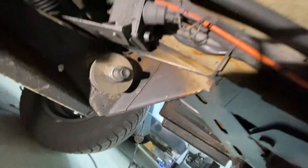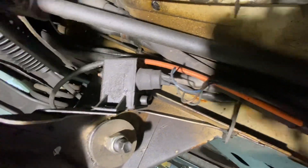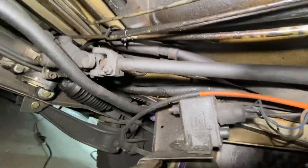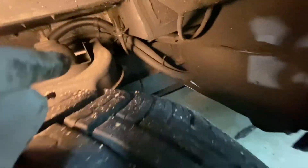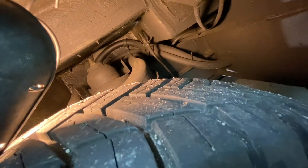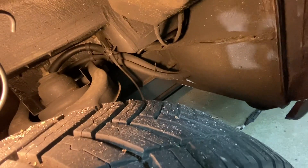Where does this go? It goes into a little part of the frame over there and then pops out into the wheel well. Let's see — I'm going to pull it out of the frame over there. There's a bolt-on clamp there. And then for some particular reason it goes down through the chassis over in front and up over there. Let's get all those unbolted — they look like 10 millimeters, and more zip ties to snip.